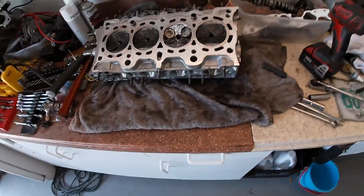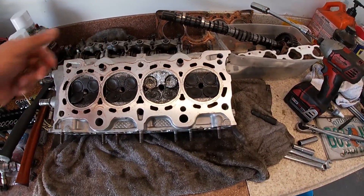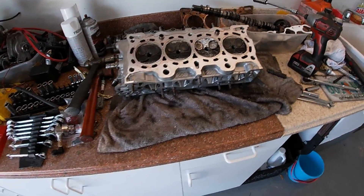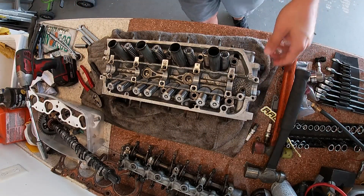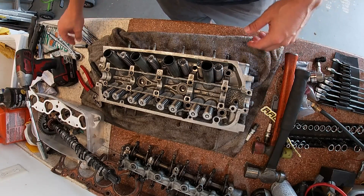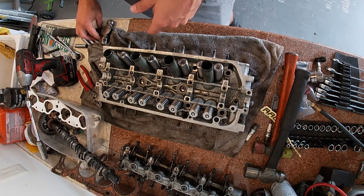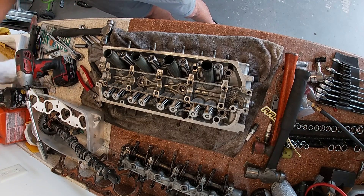I'm going to show you guys real quick how to pull these valves out of these heads, because if you're doing a stock motor or a stock head and you're going to put valves in or whatever, this is how I pull valves out real quickly. I'm going to flip it over and show you real quick. Obviously if you don't care about the valves in it, you've got stock valves that you're not going to reuse, you can just do this trick. I have done it multiple times with valves that I'm going to reuse — I just keep rags under each cylinder and bang them out this way.